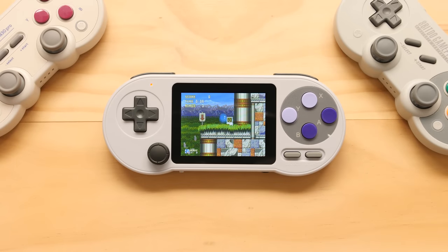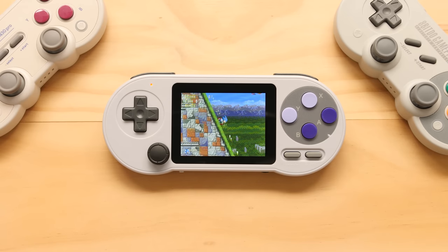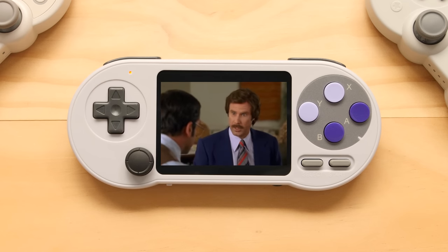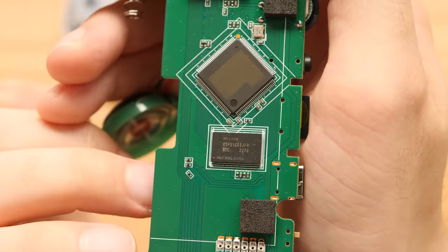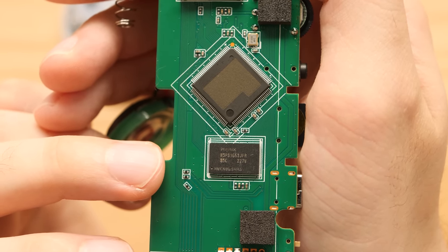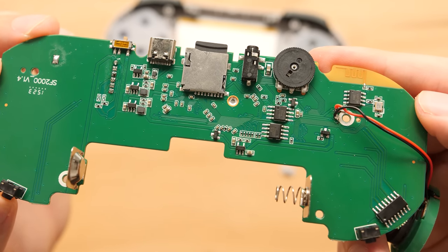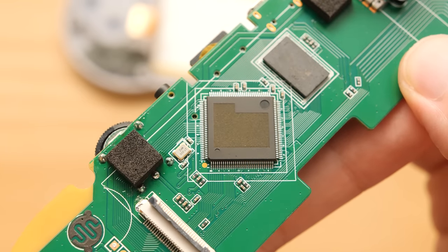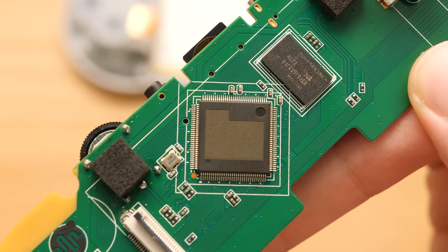I'm left with the thought that this could at least be a better product if the software were better. There are simple things we do not have access to, like remapping buttons or adding other light emulation systems. The company claims this is an SL4350 SoC, but that doesn't exist. Let's do a teardown to try and get some answers. With the back shell off, we would get a clear look at the processor — if they hadn't gone to the extreme length of sanding down the identification markings. You really only see this with ultra-budget handhelds where companies are worried someone will do a complete hardware clone. It's either a very low-end Allwinner chip, a low-end MIPS chip, or a repurposed Miracast processor like the Russian community over at 4PDA found in other Datafrog gaming hardware.